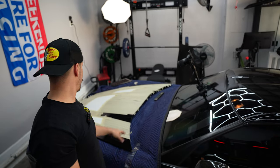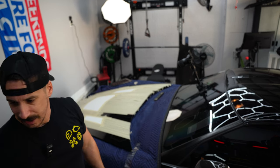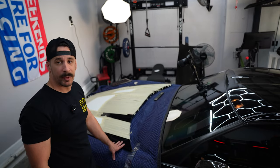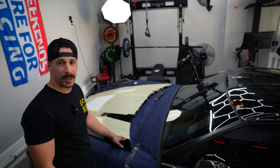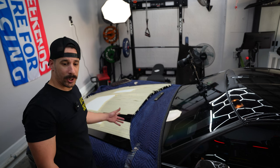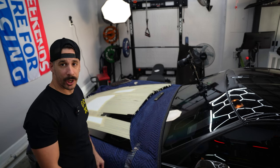You can see from behind me I've pretty much taped majority of the hood. I missed a spot here and right here because I ran out of masking tape, so I've got to be a little bit careful. I basically wanted to cover the entire hood because a friend of mine who's already done this spoke about the fact that fiberglass gets everywhere and it embeds itself in the clear coat of the paint. This clear coat is already pretty banged up — I don't want to add misery to it. So at least most of it is covered. We're going to set up the Dremel, get some gloves and a long sleeve shirt, and start cutting. There is no turning back from this, so I really hope I don't mess it up. Let's go.